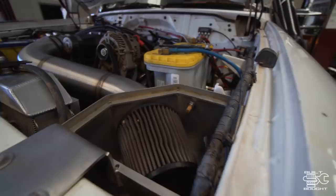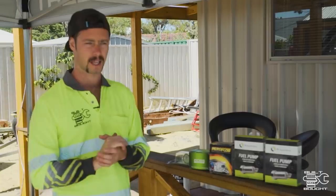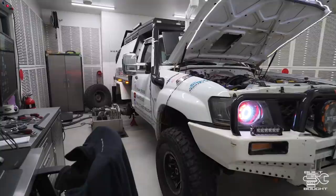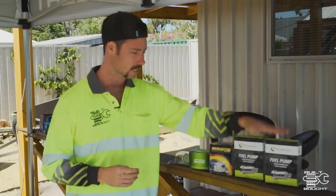So we're actually doing an episode on upgrading all the intake piping under the bonnet, which will probably be the next video to come out. But on the flip side to that, when I was at Harrop last, we had the air lid off, so we had as much air as it needed, and we discovered that the fuel system was the next limitation — it was leaning out at about four and a half thousand RPM. That's no good; it can actually blow the engine up and it obviously affects performance as well. So in today's episode we're going to be upgrading the fuel system.